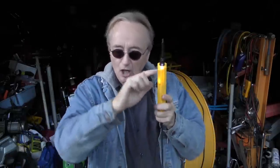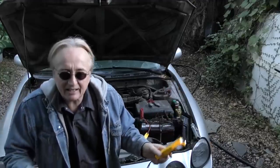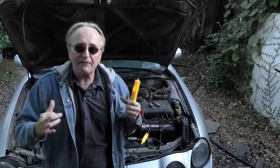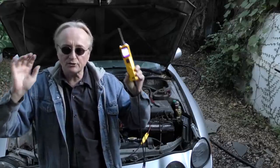That's a big worry people have. I know some mechanics that were excellent at mechanical work — water pumps, engines, transmissions — but they were afraid of electricity. They thought, 'Oh, I'm going to short something out.' Don't be afraid of it. With a tool like this, it's auto-ranging; it'll show you the actual voltage of the system you're working on and won't wreck any of those sensitive computer circuits. As long as you don't own a hybrid or a pure electric car, don't worry about shorting yourself out — working on a car with one of these, they are pretty much foolproof.